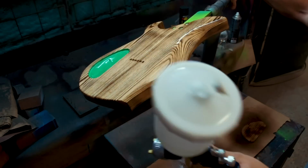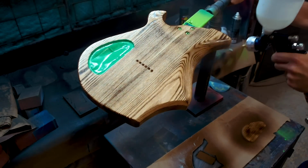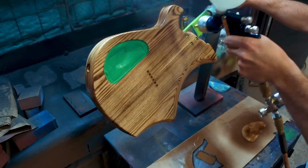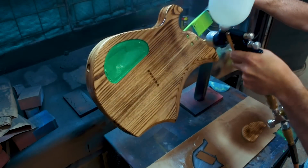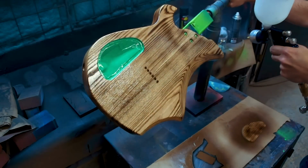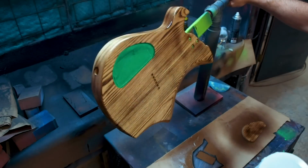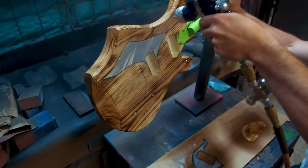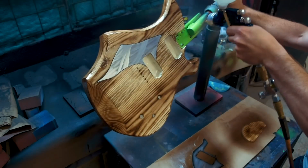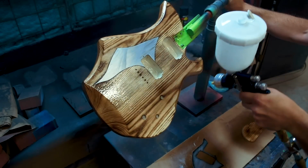It depends on what hardener you're using, whether you're using fast or slow. But even with the same hardener, it depends on how hot the day is and how much you're putting on at once. If you put on a really light first coat to make sure you're getting adhesion and to avoid any solvent pop, then maybe you want to wait 5 to 7 minutes if it's a warm day. If it's really hot and you're spraying in Florida, and at least you've got your humidity controlled but your temperature is crazy, then maybe you don't wait at all. Sometimes it flashes off very quickly, particularly if you're using a faster hardener.